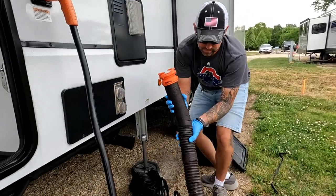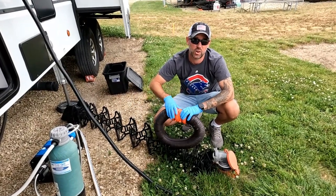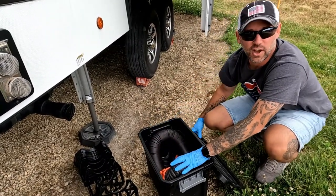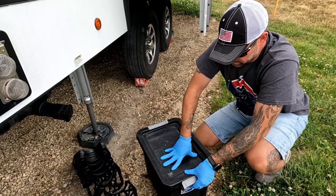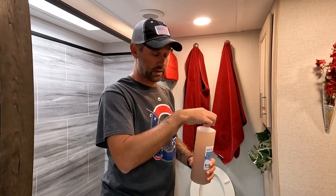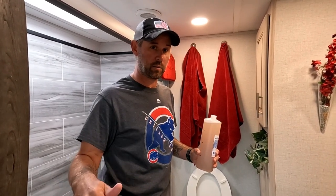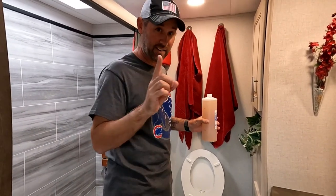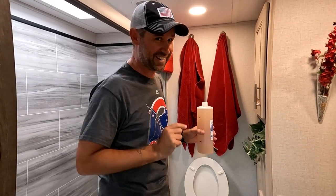Tanks are done being dumped and flushed. For this next part, always glove up — snap that together so you don't make a mess. We've got our handy-dandy black bin for all of our black tank stuff. When you're done, support your hose and make sure you put your hose support back too. See how easy that is — use gloves. After I dump and flush the tanks I have to put the treatment in. We use a mixture of Pine-Sol, Calgon, and water. I added a few gallons to the black tank so when we travel it'll slosh around and coat the lining of the black tank.